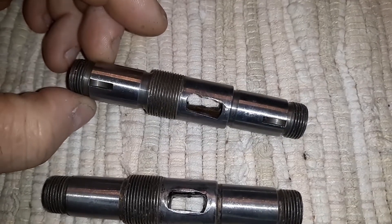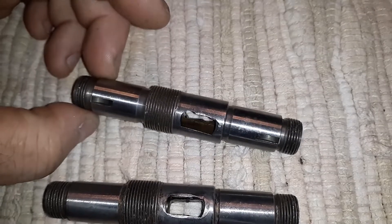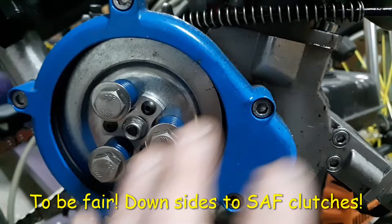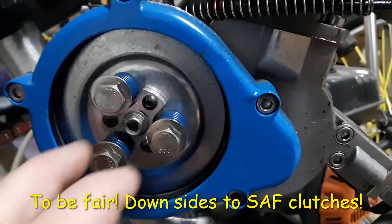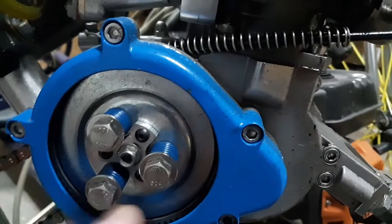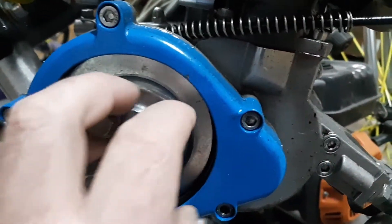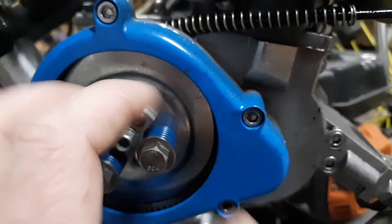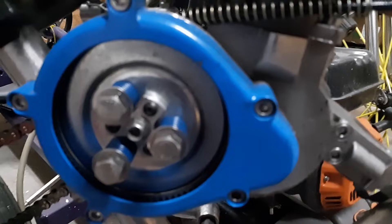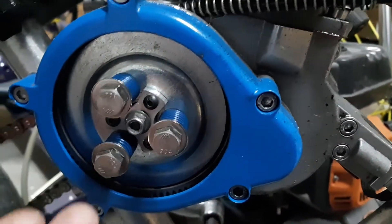You've got to be careful and watch that, because if the clutch side does that and comes off, it'll tear that engine apart. So to be fair about the safe clutch setup — one big thing is it requires a little more skill. You have to cut a cover, take out the old clutch assembly, put this in, install it, little odds and ends. Mechanical skill-wise, this is up a level.